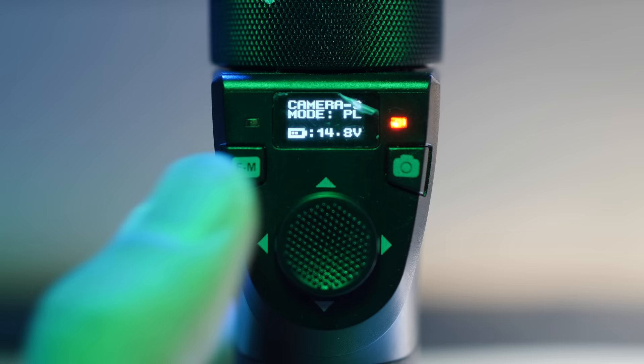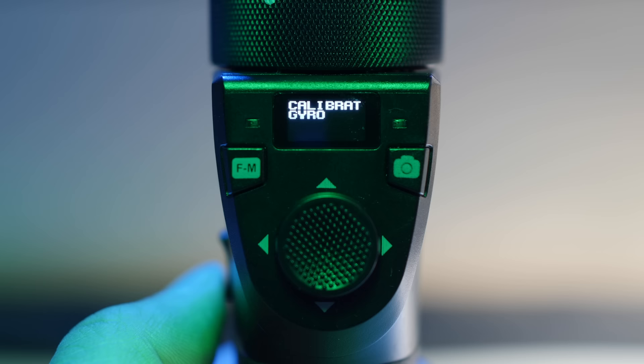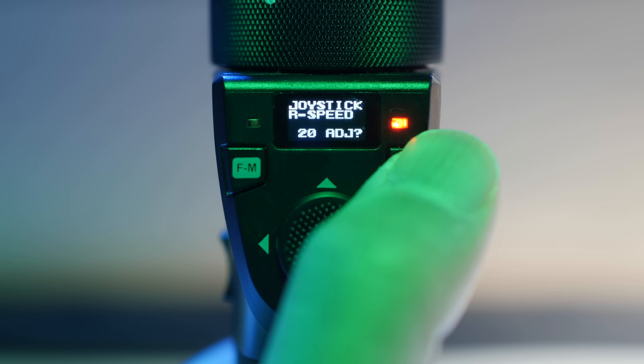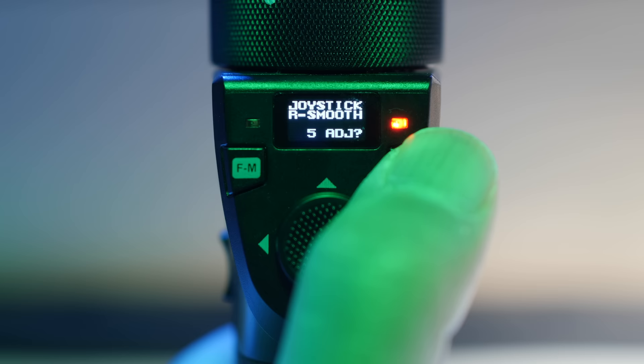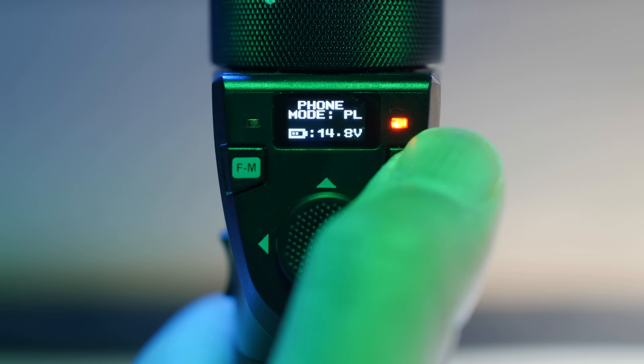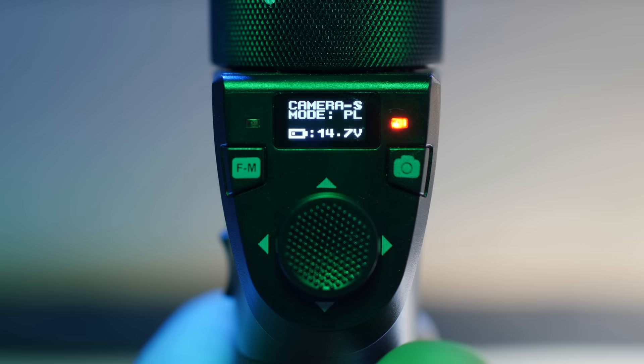If you go into the menu system, you can adjust a couple of awesome things. You can calibrate the gyro and accelerometers of your motors, and you can even get down to the motor's response — changing the speed of response, the range before it activates, and more. They've made this gimbal so you can balance it out of the box and set it to whatever camera profile you're using: action camera, iPhone, light, medium, and heavy DSLR mirrorless cameras. There are five profiles included, so you calibrate and you're pretty much good to go.